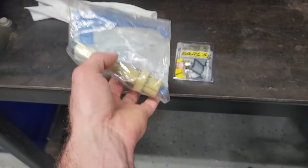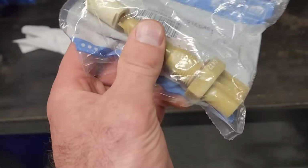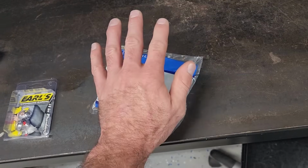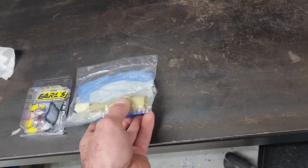Now the LS7 that this came with, the oil temp sensor was in the bottom of the dry sump, but because I converted this to a wet sump car for the turbo setup, I got the oil pan from some kid locally. It was out of an LS2 Corvette with God knows how many miles. It was used. I had to clean the pan when I got it, so I'm surprised it lasted this long. Basically, this sensor taps right into the side of the oil pan and functions as the oil level sensor and an oil temperature sensor. So I'm hoping to knock that out as well, hoping we don't lose too much oil.